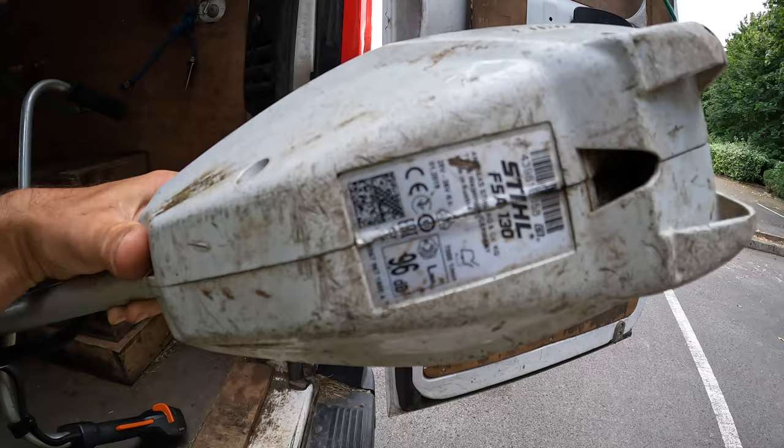So if you're running a battery trimmer, line trimmer, whatever you want to call it, and it just stops working and you've been in dry conditions, check it for dust. It's pretty easy for me to take these things apart — they're not under warranty, I've got nothing to lose. But if you're using a machine that's under warranty, you may want to take it back to the shop. This Stihl model has a sticker right over the join in the casing which you have to cut to get in there, so if you did get in there and it was under warranty, they'd say your warranty is void. If you've got nothing to lose, take it apart, look for something obvious in the connections or wires. The simple solution for me was that it was just full of dust, which wasn't allowing those connections to make contact.